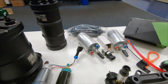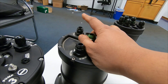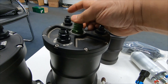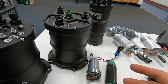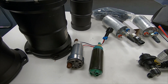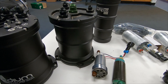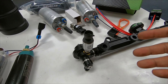The fuel rail returns back to the surge tank, so it forms another cycle using two different fittings. It has two cycles: it's continuously being fed and feeding the stock fuel tank, and it's continuously being fed and feeding the fuel rail. So you never run out of fuel, there is no cavitation, there's no lack of fuel — even though this is small, it's constantly being fed by one of these pumps. This will actually work with a stock pickup pump; you really don't need a big pump to feed a surge tank. The reason you would want something like this is it increases the efficiency of any pump in the system and makes sure the fuel rail is always full of fuel, with no gaps — the fuel injectors are always being fed.